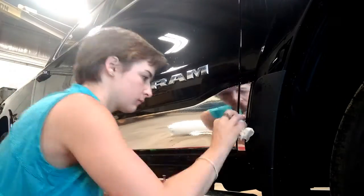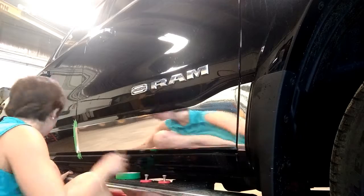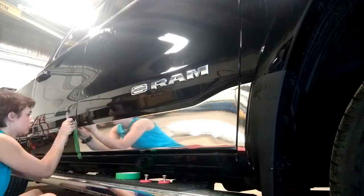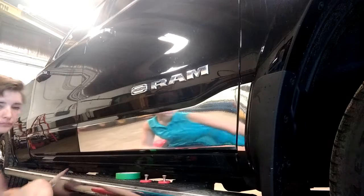Now I'm putting glue remover on it. I'm showing you how that chrome residue comes off the clear coat — it's got to be removed with glue remover. It's a pain, but it's got to be removed. Seal all my edges, take all the extra glue off, make sure there's no tags, and trim a nice straight line at the door edge there. Ta da!